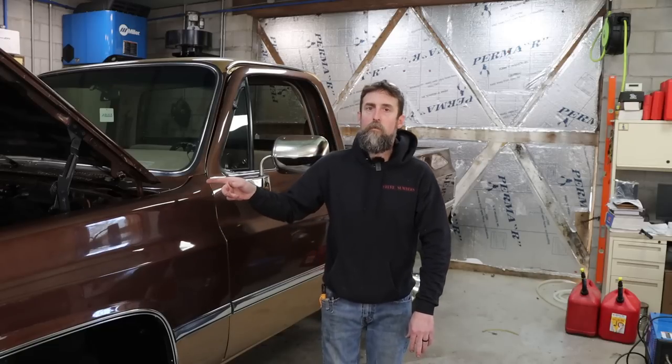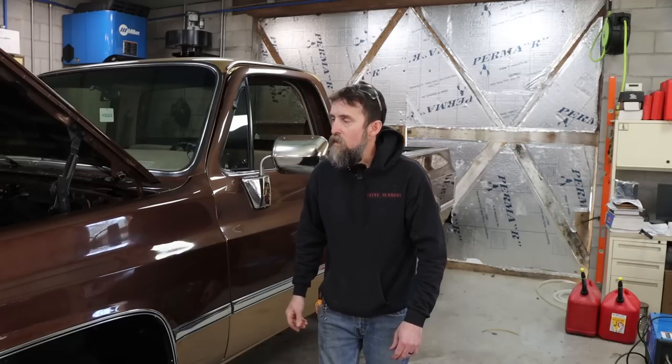Something pretty important: make sure all sensitive electronics are unhooked before welding on this truck. Now we've got a sensitive computer in here that doesn't like voltage spikes — and welding can cause all sorts of problems. I've seen people cook the computers in vehicles by welding on them. If you can unhook everything, that's a good idea. Also make sure your ground clamp is hooked as close as possible to what you're welding, which is good practice anyway.